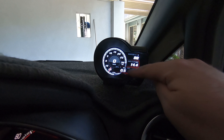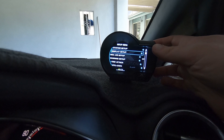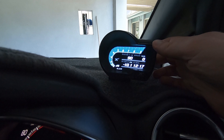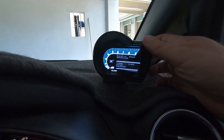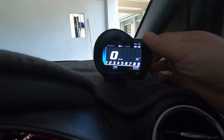Someone asked if you can change the max RPM figure shown on the tacho. To do that: press the middle button, go to Display Setup, then Item Setup, and scroll through the gauges until you're on the tacho, then select it with the middle button and use up and down to adjust the max value. It was just over 6000 RPM — now it's been taken up to 9000 RPM. You can do that for each individual gauge.